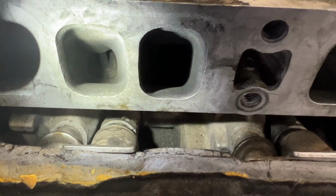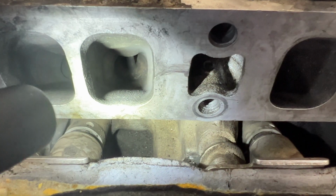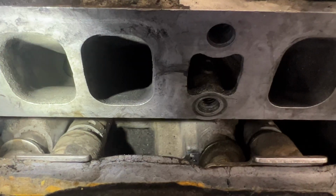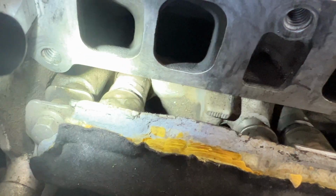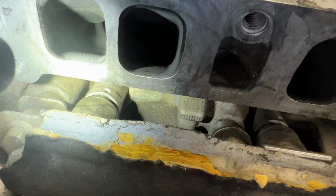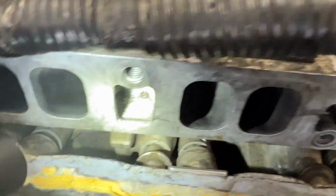And I think just that wire brush, you can see, they're not gonna get them perfect, you know, this ain't a 5-minute job. You gotta take your time and really scrape these valves to get all that carbon off. There's that one, cylinder 1. But you can see that is 10 times better than what it was, even on the sides there. That looks good.